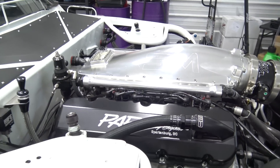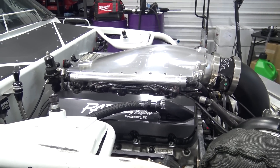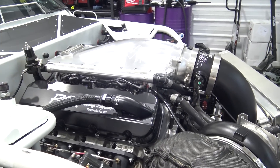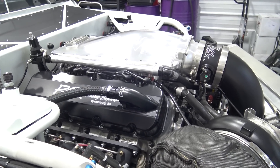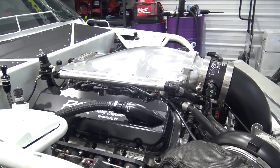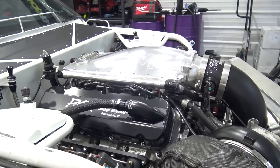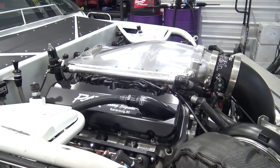What we're doing is pulsing the injector via the ECU so you can double check your wiring or make sure the injector works. This will also work if you've got a different brand of injector that's rather common and likes to stick. This will also work with the injector out - you have it plugged in. You can put some PB Blaster on the top of it and clean it out, or blow air through the bottom to clean it. If you're going to have a methanol fuel system that's going to sit for a while, this is a good idea before you pull the injectors out of the car.